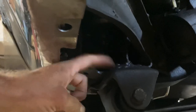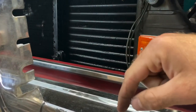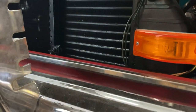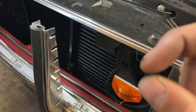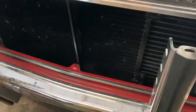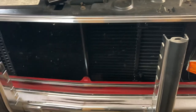For the body mount bolts, they go up through here, but you're going to need to run your bolts down because you can't have any protrusion up through. So I just use 3/8 bolts — I think they're six inches long — dropped them down through. The hole where they go is reinforced with tubing on the inside so you can pinch it and it'll hold. You'll see the intercooler is just barely this far from touching the bolt head. I just use an impact on them — you don't even need to put a wrench on them, but I did make sure I could slide an open-end wrench in there in case I needed to take the intercooler out.